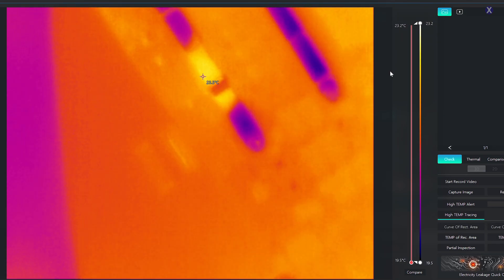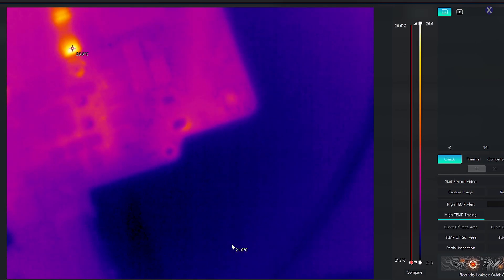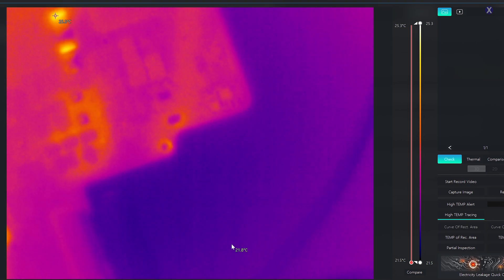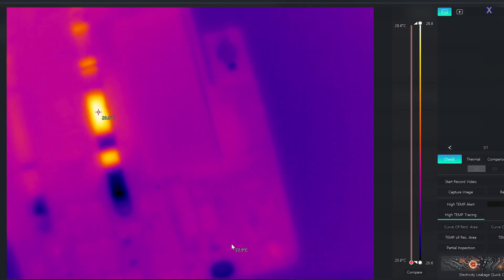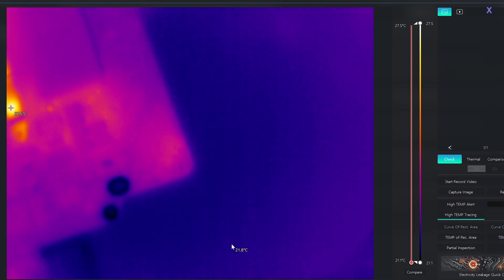Let's see if there's anything else going on. I'm going to check around this area. You can see now it's getting a little bit brighter when plugged in. If I unplug it, it should completely go out — which it does. And if I plug it back in, it brightens up. So we're going to take a look mainly at this area over here under the microscope, because I don't see anything else obvious.